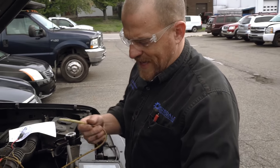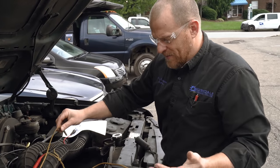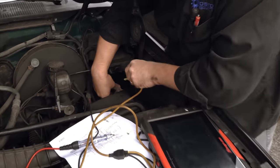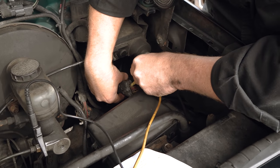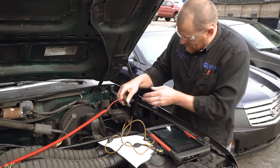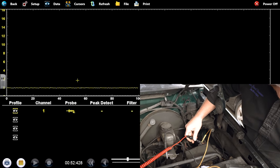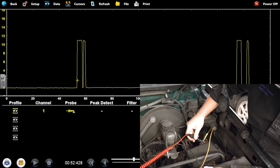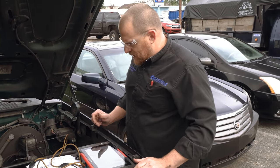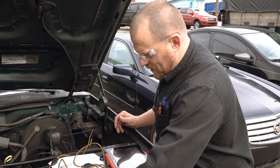I broke out the lab scope because I can't really show you the Hall effect signals without it. I first want to get a voltage reading of the PIP wire — key is still on. It's fixed at zero. Then I'll show you the same check — you'll see the square wave I'm generating on the PIP wire, making it spark each time. When I crank this, we should have a square wave. From memory it's a zero-to-10-volt square wave.